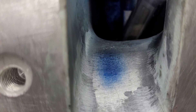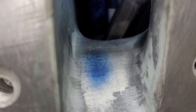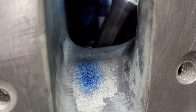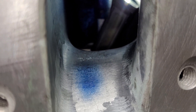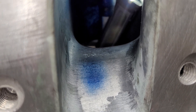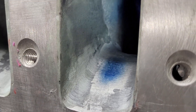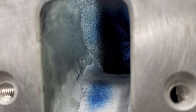I did do a little bit of work to the short side radius because the speed differential was just ridiculous. I took a few thousandths of material off to try to get the short side closer to the speeds I think it should be. Now we do have some blue on the short side and you can see we've got some going down that wall.